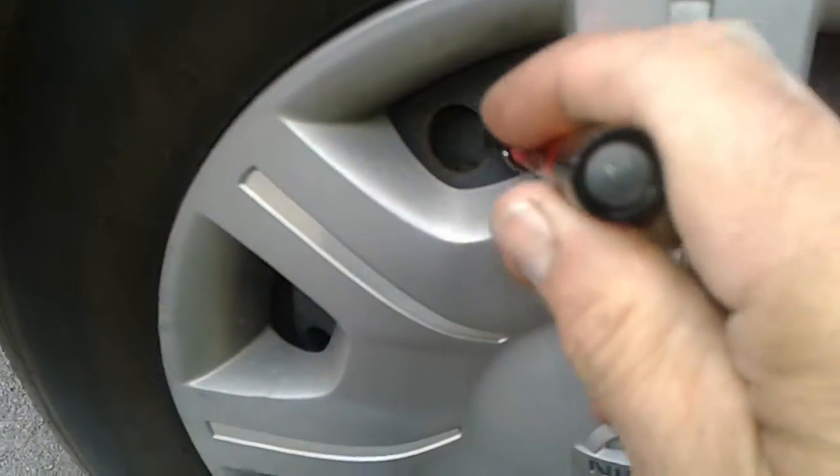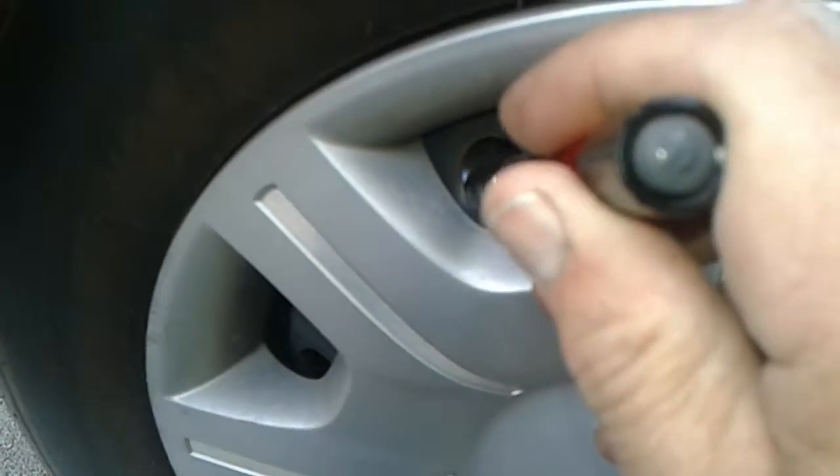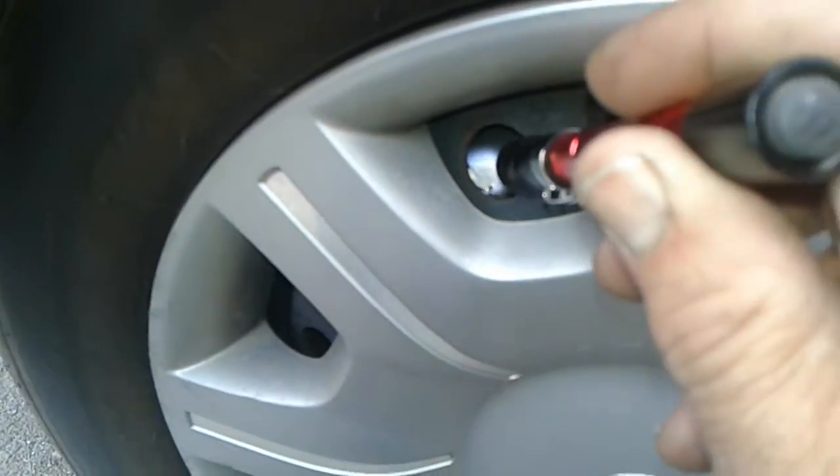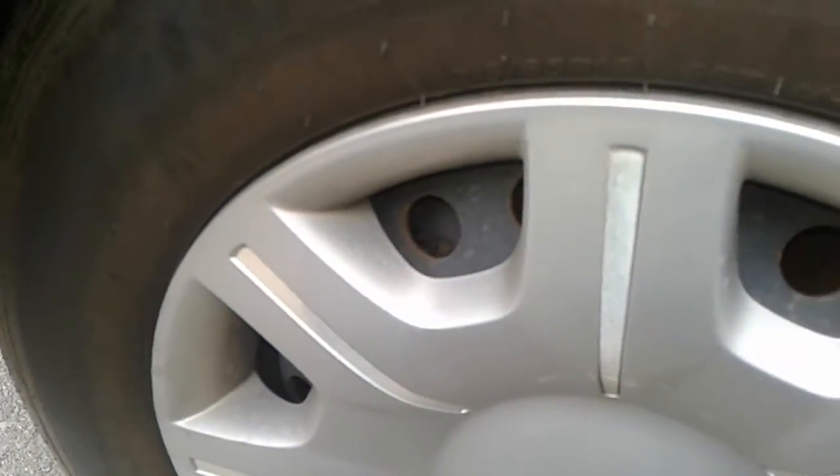And on your left front, brakes the same, about 30,000 K left in it. Lots of brake pad in the front. Front tire again down about 30%. I would definitely be negotiating a set of front tires, and probably back as well.